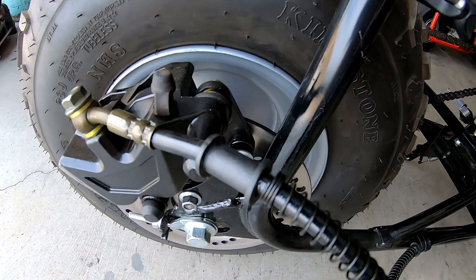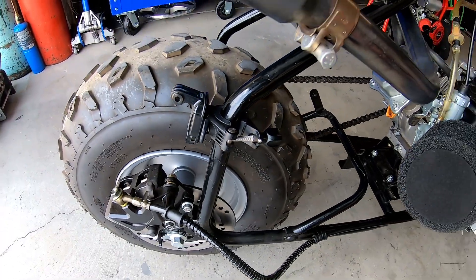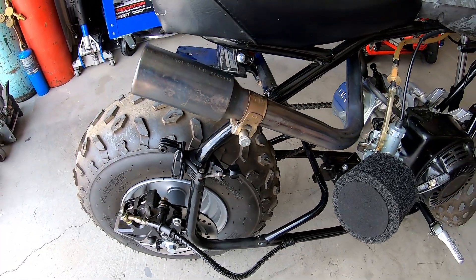With the 265 cam in that engine, the 6-to-1 ratio puts the bike more into the optimal RPM range — up in the 6,000–6,500 RPM range versus 5,500 with the 5-to-1 ratio. The 6-to-1 ratio is going to be a lot easier on the clutch for running a straight chain. I was also able to test out the disc brake conversion for the first time — it definitely works a lot better than the stock drum brake. Definitely an upgrade.